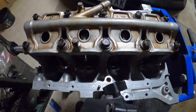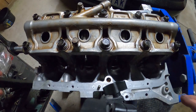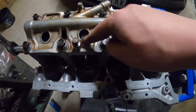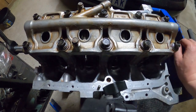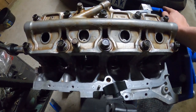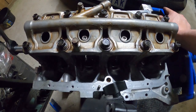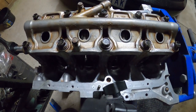All right, snag number 347. Watch here and here. So now we've got the bigger con rods and everything in there. I've clearanced out every cylinder so it doesn't hit when it spins around. But now we've got an issue with this thing, the girdle, whatever you want to call it. Watch just here when I spin the engine. All the way around, beautiful, and bang, just here and here. And then back the other way. Beautiful, bang.